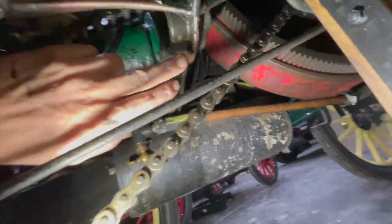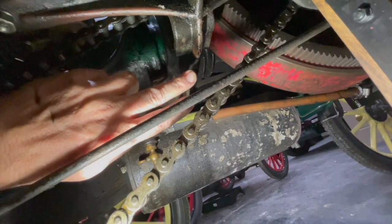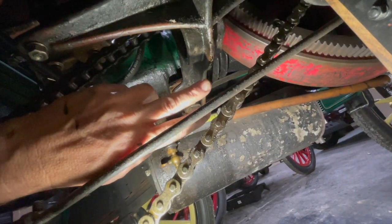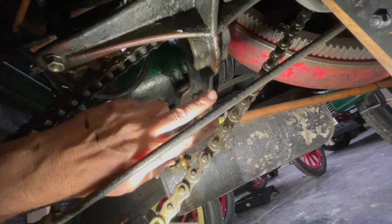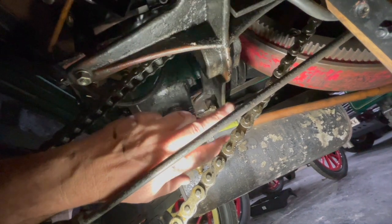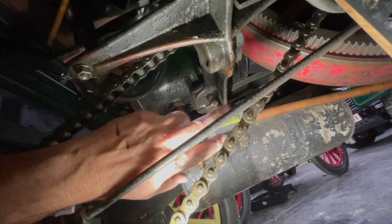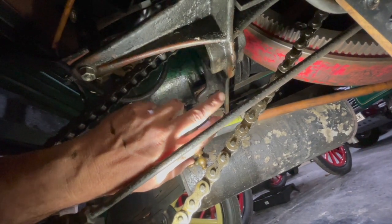While I'm down here, I'll show you — we actually had a starter motor fitted to this car. In 1904 it obviously didn't come with an electric starter motor, so we had this ring machined and fitted onto the side of the flywheel. Although the car was never hard to start, it's so much easier with an electric start. I think the starter motor they used was off a new shape Land Rover — a high torque starter motor — and we've got a little battery box in there. It just makes starting so much easier.